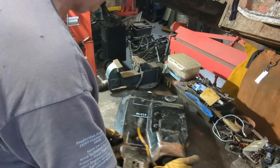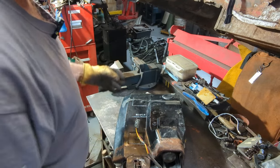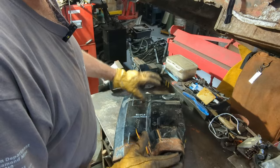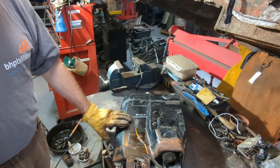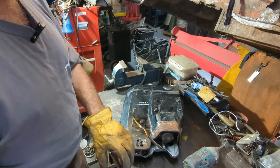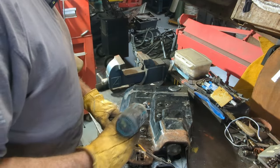What holds them all in are the bolts here for the motor. With the window all the way down, it's more compact. These four bolts here hold that whole assembly in on those tracks — the tracks guide it, this holds it all in. So let's get those bolts out and see if we can slide this out of its tracks. I'm not going to take the tracks out, only these four bolts to pull the whole regulator and window assembly out of the case.